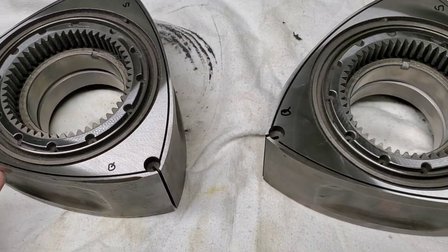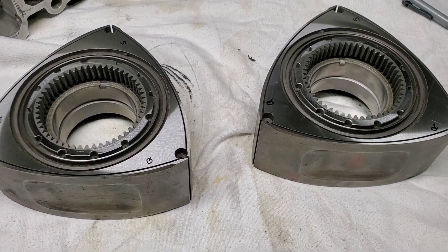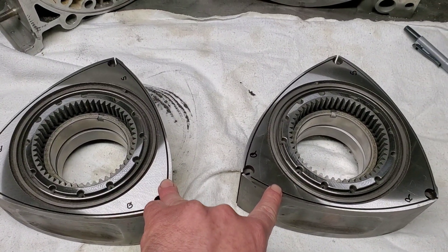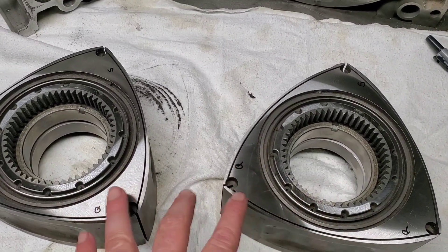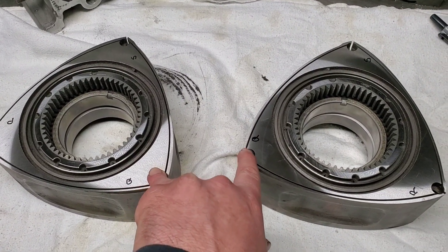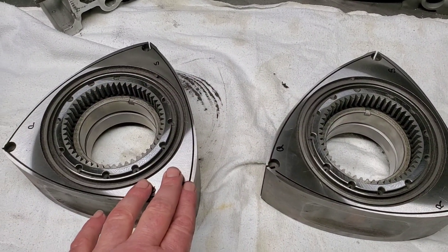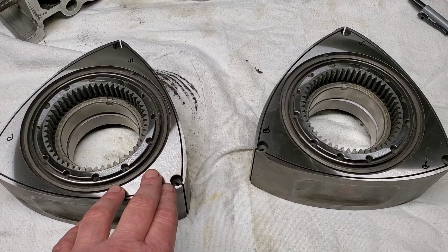They're looking good — race bearings, side clearance, we're looking good. This service is available from Mazda Tricks. Next they're going to go out and be balanced. This was a matched pair and I do have the original factory counterweights, so it'll be interesting to see how much modification we need to do to basically high-speed balance the rotating assembly beyond what the factory does. I know we're going to get some change — it'll just be interesting to see how much.